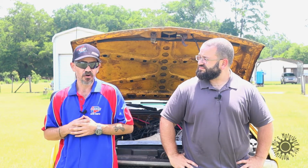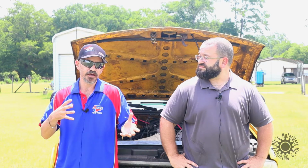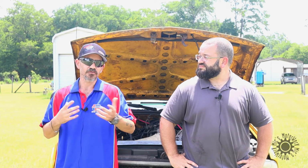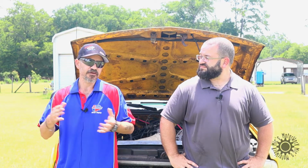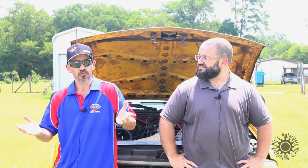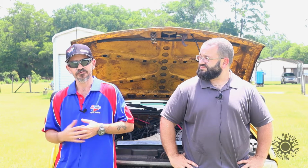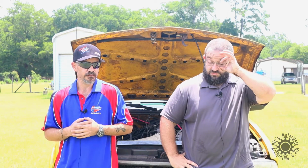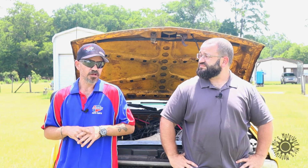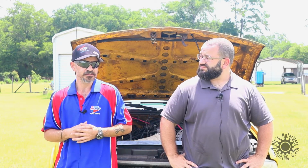The other big thing is the wiring harness. The wiring harness to convert from the 5.3 to work with my factory BCM and my factory controls had to be rewired completely for this application. And that harness actually came out of a 2004 Tahoe, which is the same engine, but the harness had to be stripped completely down and rewired. I got rid of the fly-by-wire cables to allow for the cable drive. So a lot of wiring harness had to be removed, installed, and added to make this application work.